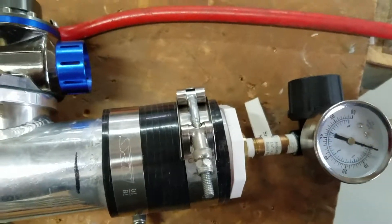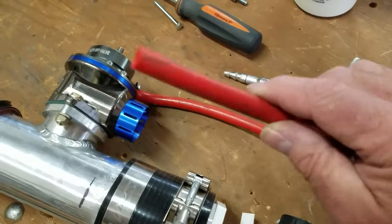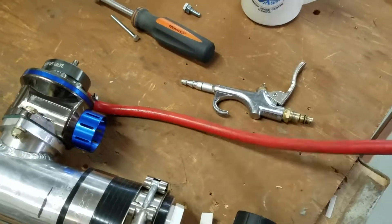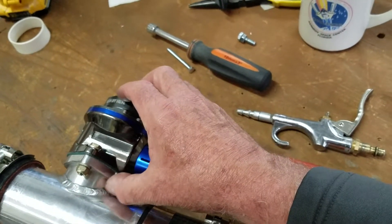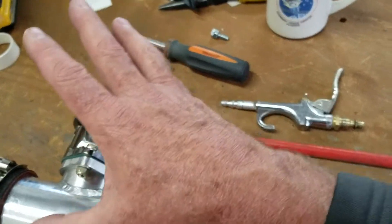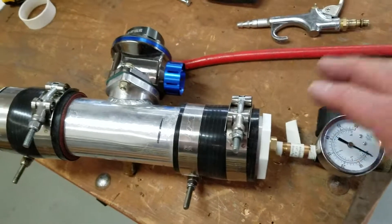This right here is the reference line to the turbocharger — I'm not going to get into that now, that's going to be a separate video. But this connects to the compressor outlet on the turbo and it's a reference signal, which will work with and against the spring pressure here and cause other kinds of changes in the pressure in your system. If you don't understand that, it's something you should also study.